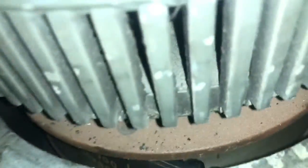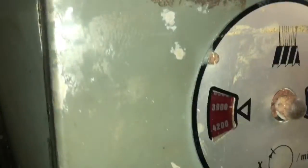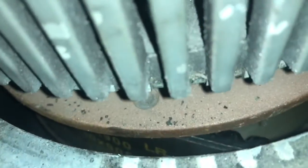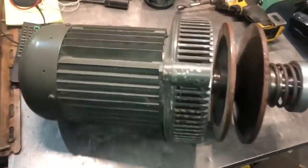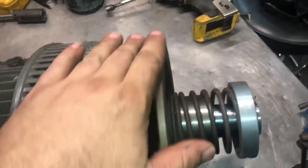So in my two minutes of research I've concluded that I'm gonna have to get the belt off to get this out — this has to come out in one piece. What they recommend is putting it to the highest speed so you get the most slack in the belt. I actually put the bolts back in to connect that ring so it's one piece, and then I finessed the belt out around the bottom of the pulley with a screwdriver, just rotating it around, and the motor came right out.